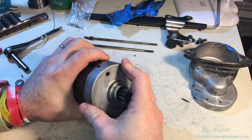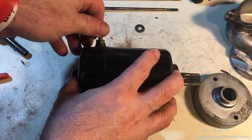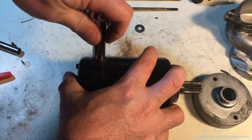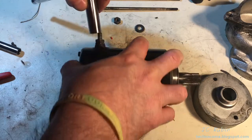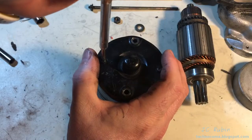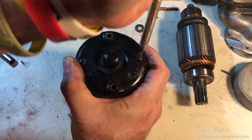I drop the cover back on and take it back off — I don't feel any drag whatsoever. Moving on, I take off the nut on the post and loosen the nut under it just a couple turns with a 7/16, so that nylon material doesn't bind on the cap. Now I pull out the armature that should have already been removed, then break tension on the two screws on the end cap with a fitted screwdriver — they're in pretty tight and put up a fight.